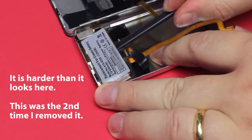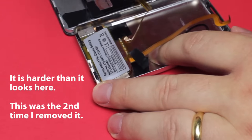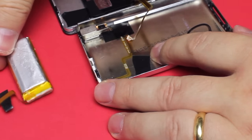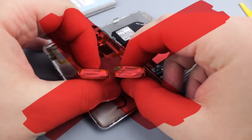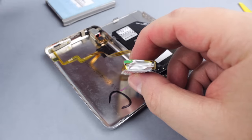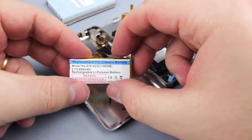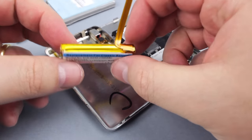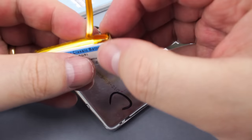Replacing the battery is really simple. You just need a plastic tool underneath and force it up slowly. The battery is kept in place with just an adhesive — just be careful with the bottom ribbon cable that also passes under the battery. What I did wrong: I was ambitious, so I ordered a battery with a greater mAh capacity, not realizing it would be thicker as well. It was made for the previous, thicker generation. I had to put everything away and wait to receive a second battery with the proper size.